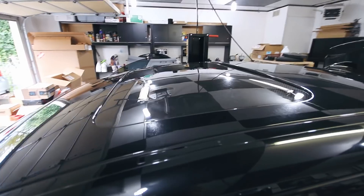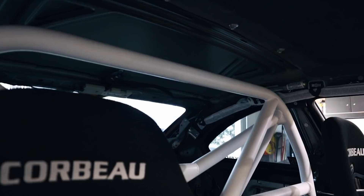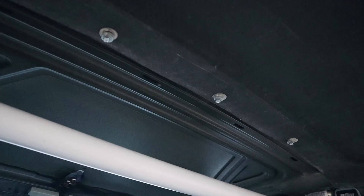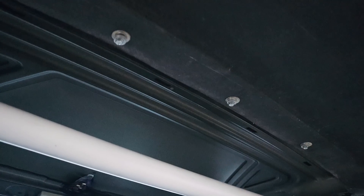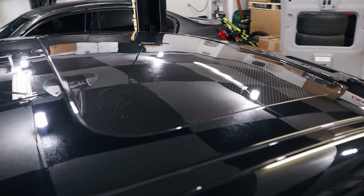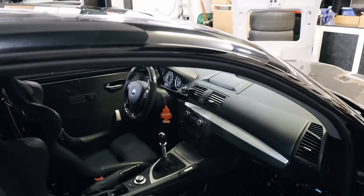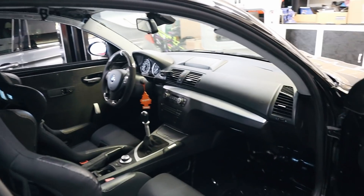Going through the footage, I realized I never showed you guys what it looks like at the end. So here we are again, eight or nine months later — I filmed the intro and now I'm filming the outro. You'll notice I've got the roll cage in here now — spoiler alert, that's going to be the next video. Here you'll see I've got three screws with a stack of washers holding the sunroof delete plug up there. I wanted to find short bolts; I was worried these might be too long, so I stacked some washers on them, drilled a tiny pilot starter hole, and self-tapped them in. And as you can see, it looks great — fits flush, looks really nice. Definitely happy with it. You can feel the weight reduction for sure, and since it was at the top of the car it definitely feels a lot more nimble and less top-heavy.